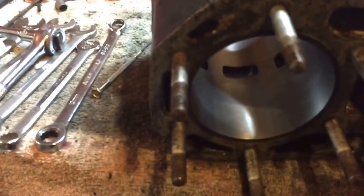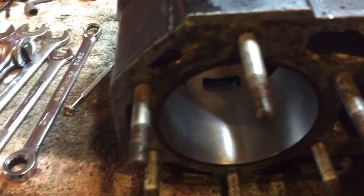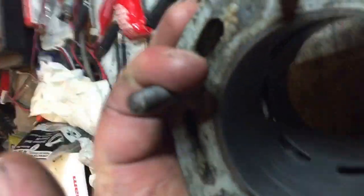If you check out the top of it, the gouge goes away, so it looks like the motor ate something at some point. I'm going to run it instead of re-boring it because you get a little bit more wear out of the cylinder if you just throw some new rings in there.